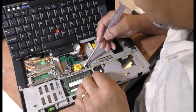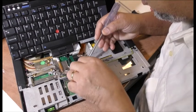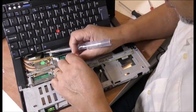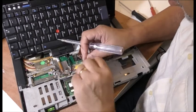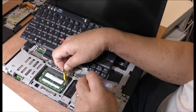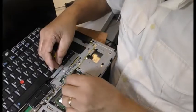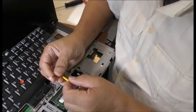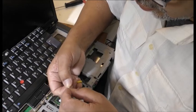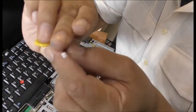I need to move this somehow — move this clip. I find it a little bit difficult to move but I did it without breaking anything. The sides are holding down. Okay, so that's it — that's the BIOS battery out and I've got the new one to replace it.